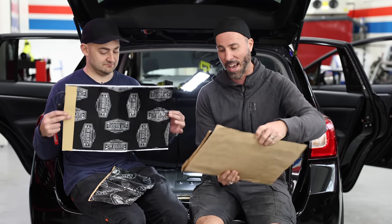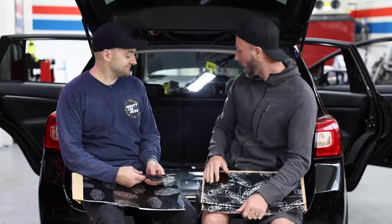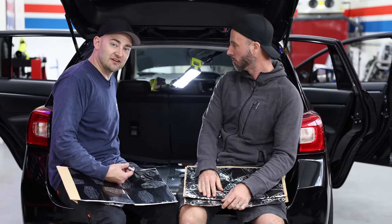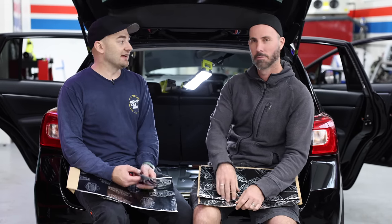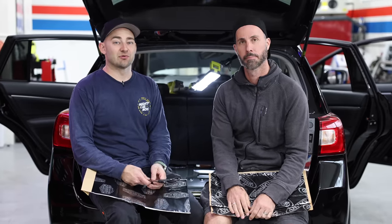So this is something that has been particularly beneficial when we've been working on really crappy cars, pretty much all of Marty's. But today, we're going to do a little bit in the back because it's all pulled apart anyway and it will make it sound mad. And as a demonstration, here's a solid bit of sheet metal and here's the bit next to it. So that just acts like a giant drum skin. And resonates. So the idea is to sort of add weight and bulk and mass to it so that it can't as easily vibrate around and cause problems.